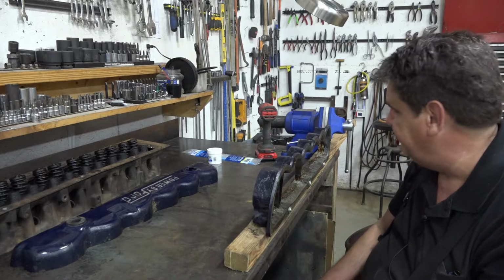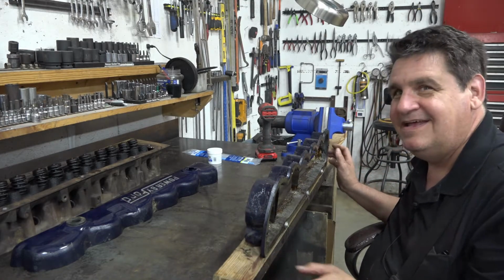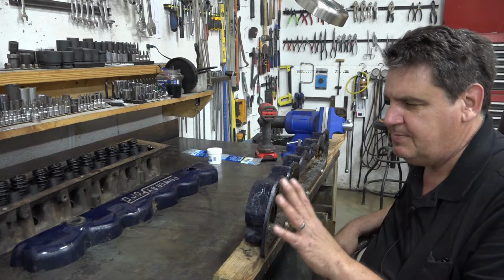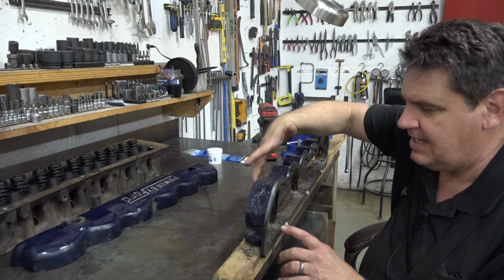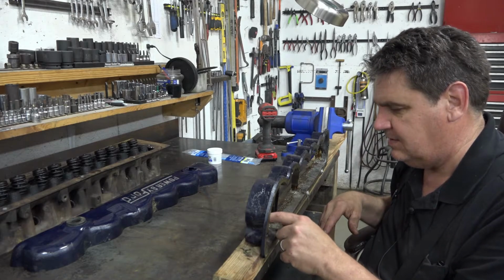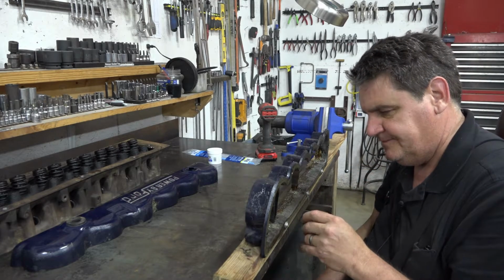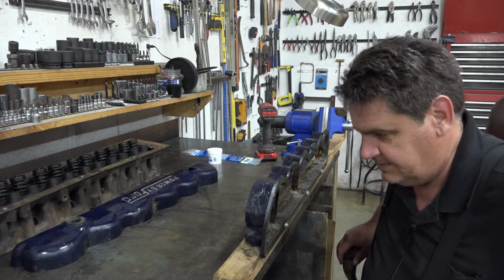But anyway, now let me show you where you think you got a good braze in there, but I actually missed a bunch of spots. Because of the way I put it together, where I push the top portion down inside, or outside, I'm sorry, of the bottom, you're trying to braze inside there and you can't really see very good what you're brazing. Like I said, the principle with the roof and shingles, you lap everything the way your water runs. This was an accident waiting to happen. But fortunately, it's not a huge hairy deal.